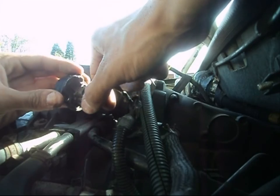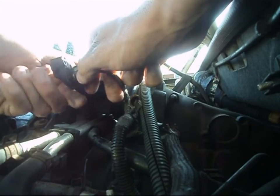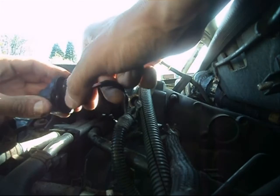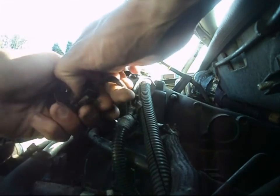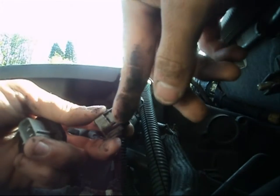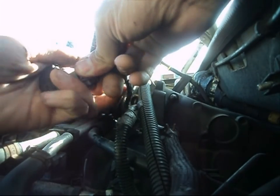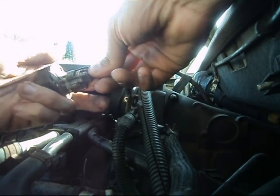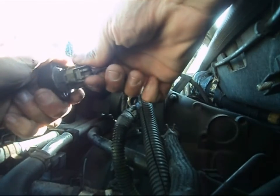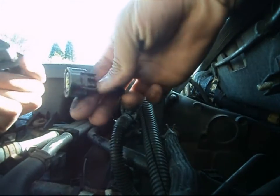Alright, now if we're taking a look at the wire harness itself, I'm just taking a quick gander here. Trying to find a clip. I'm not finding one. Okay, there's a tab here. Let's see if I can remove it. There we go, look at that. So right here, if you just depress on this guy and give it a tug, just like so, you can actually hear a click. Hear that? Okay, so it's locked into place. You just have to depress on this little pin and out it comes.